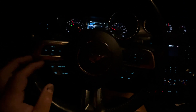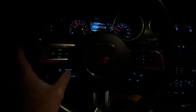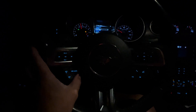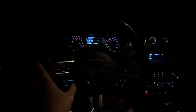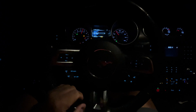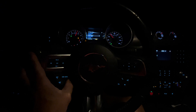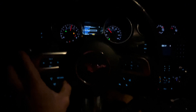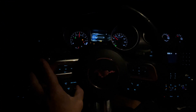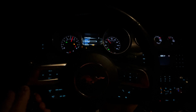So I'm going to put it in second gear and bring it up to about 3,500. Hit this off button, floor it - and that's it, it stays at 4,000 RPMs. Then let go. You see it actually keeps it at 4,000. Let's go past it and then hit off - it'll bring it down. That's right, I'm to the floor, it'll bring it down if you're past it, and it'll work properly.